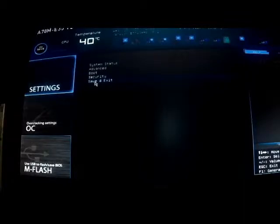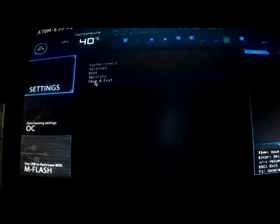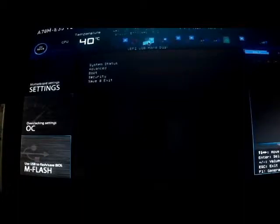Now, if through Windows 10 you can make a recovery USB stick, and you've done so, and I have done that, it's plugged into the back of the machine, and it will just stay there. It's the recovery disk. If there's a catastrophic failure on the hard drive and the machine won't boot up, I could turn it off, turn it back on, hit my hotkey of delete, boot into my BIOS, and then select whichever USB I want that stick is plugged into, move it to the primary position, save and exit, and then when it would boot back up, it would boot into the USB stick. The USB stick has the bare minimums. It will get the system up and running to the point where you can do a recovery.